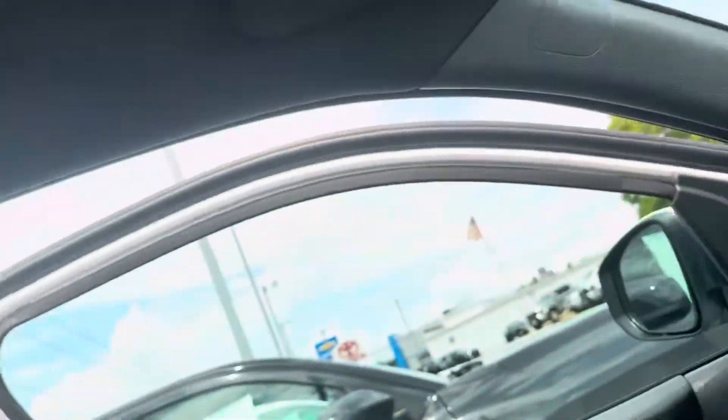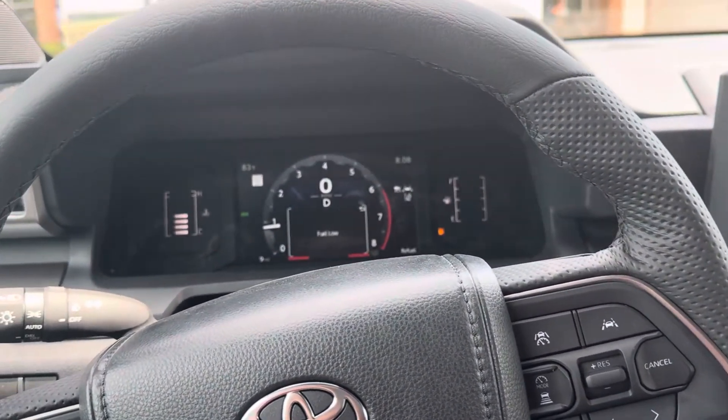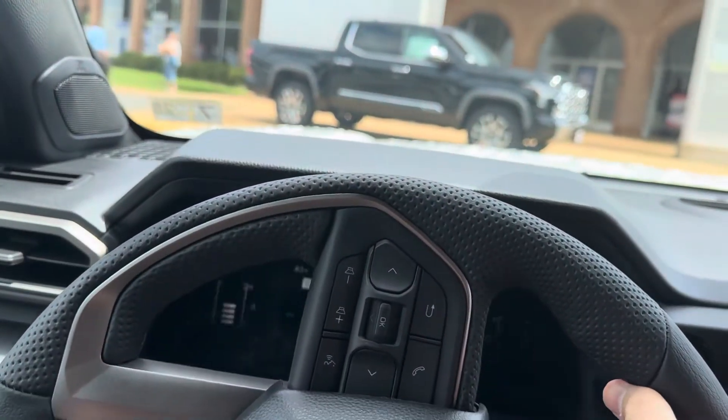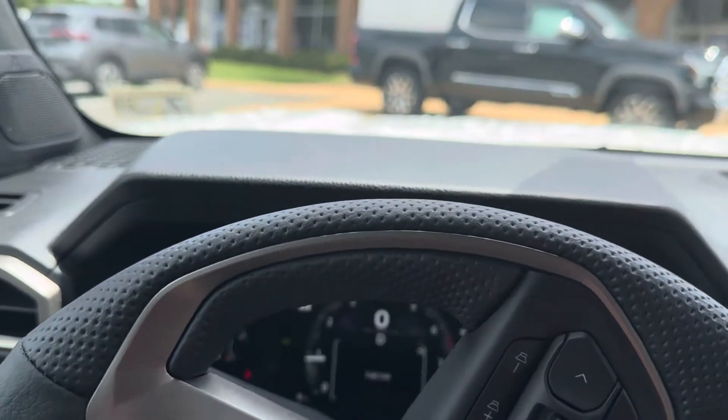Something very expensive could break. I'm not going to do this real hard, but I want you to see what this looks like. I'm going to put it in drive, move forward, and then turn the steering wheel hard. You're going to notice that even though I'm applying gas, the truck's really not moving — that's binding. The driveline is binding up because it's really trying to break something. I'm going to get out of four-wheel drive now and back into my parking space so I don't damage anything.